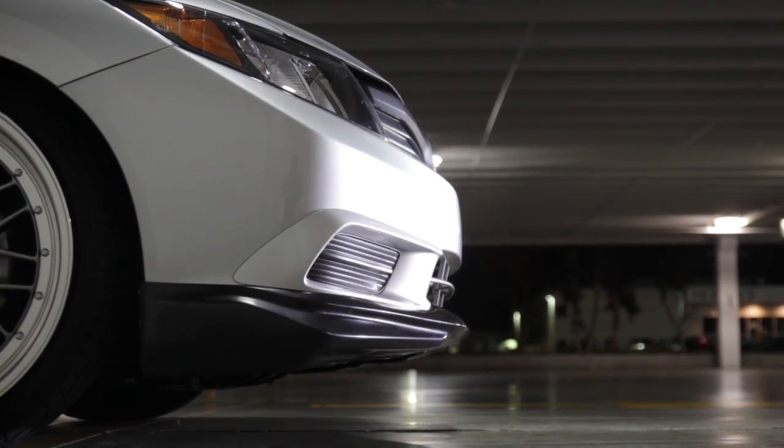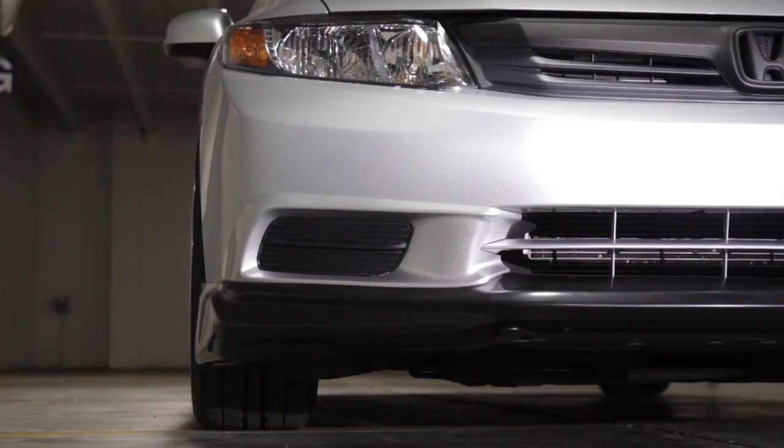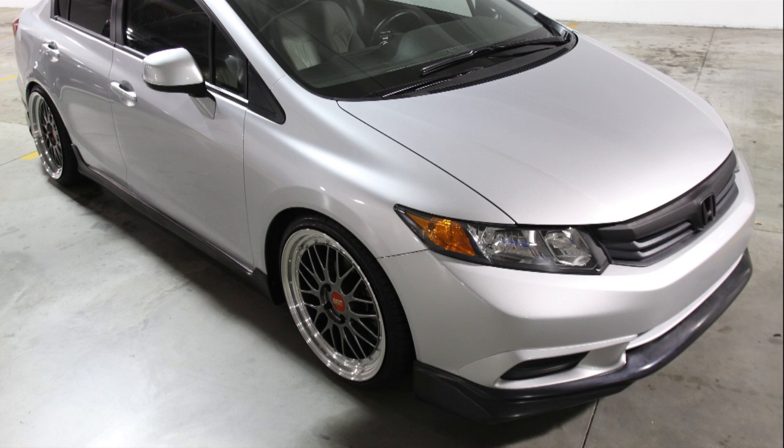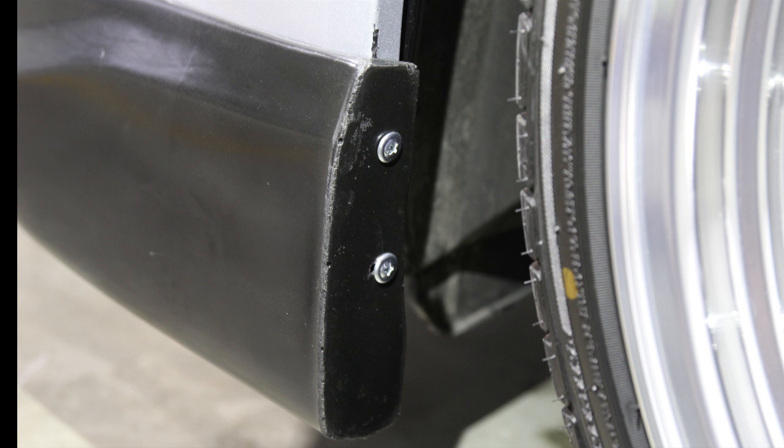There are a total of seven holes on the front lip. I reused two — one on the left, one on the right — with self-tapping screws right into the front bumper. On the bottom, I used three self-tapping screws to hold it in. I didn't use the 3M tape on the front because it fit pretty well, though it did scratch a little on the right side since it was a little tight. You may have to heat it a bit depending on your application. If the polyurethane is too hard, heat it up to stretch it out — but don't overdo it or the kit will get flimsy, kind of like dough.